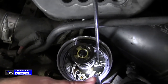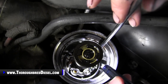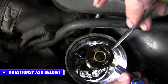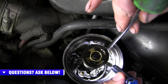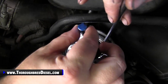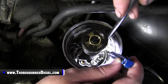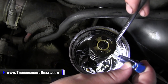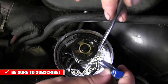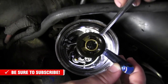We wanted to show you inside of the canister what was going on here. Here is the drain valve. What happens with this drain valve — when you take the oil filter out of here, that allows this to come up and lets all of the old residual oil in the filter housing drain out. That way you don't have contaminated old oil on the outside of your new filter. When you set your filter down, that closes this valve and the truck is able to make oil pressure. If this is open and you use the wrong size oil filter, you might as well have a hole knocked in the side of your block because it's going to definitely hurt your oil pressure. This is the importance of using the correct filters.